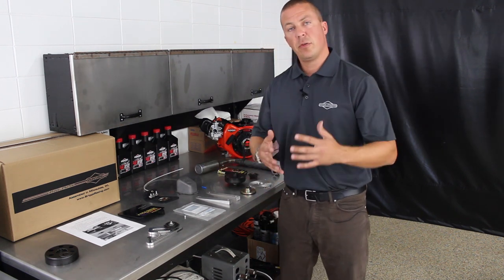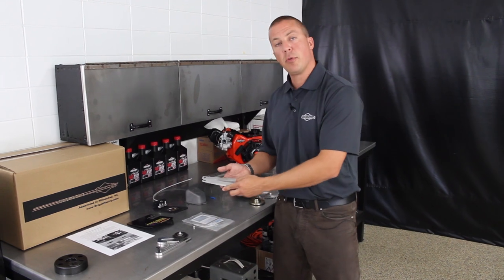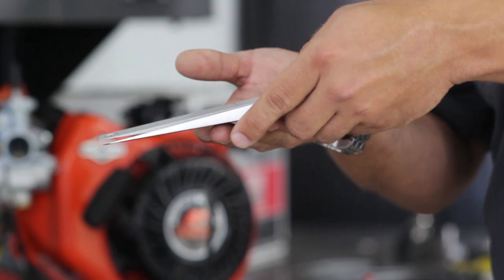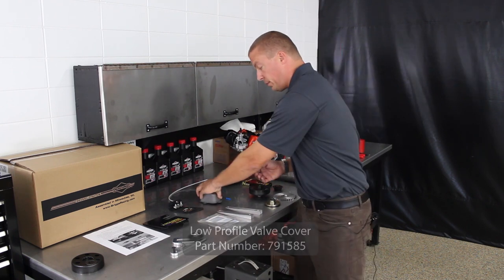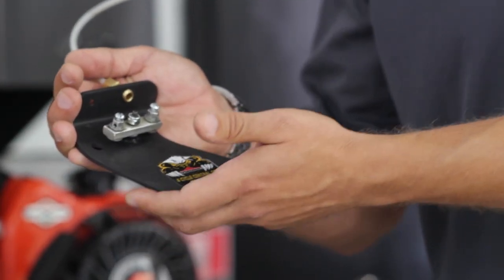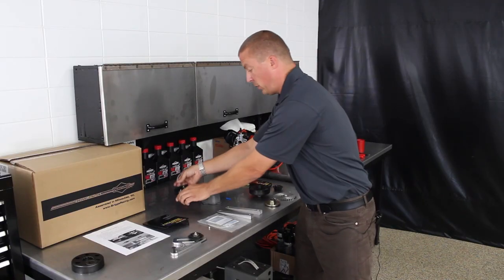There are some minute differences between the sleds and also depending on age, so please be aware of that. The Polaris, because of the original engine layout, requires a slightly different approach to putting the engine in. This is a set of shims that tips the engine forward so you get clearance on the firewall. Also improving the clearance on the firewall is a valve cover with a much lower profile. On earlier Polaris snowmobiles, you will need to amplify the throttle input — this is a simple aftermarket system from 4CycleCentral.com, available through several of our dealers.